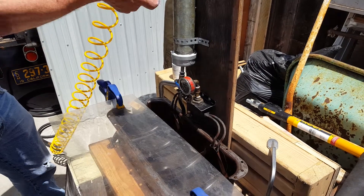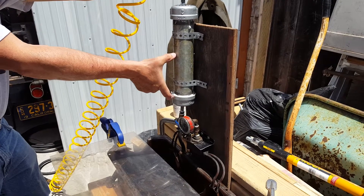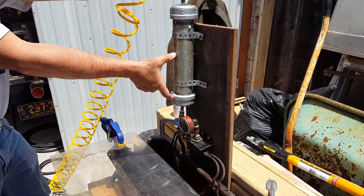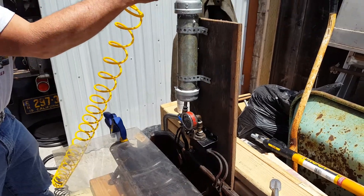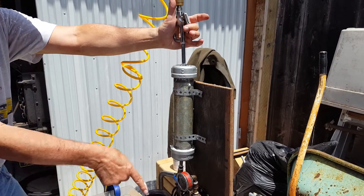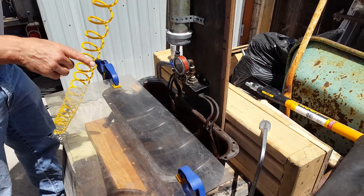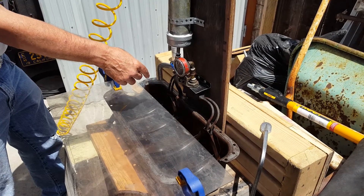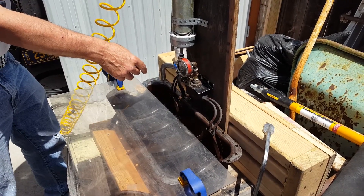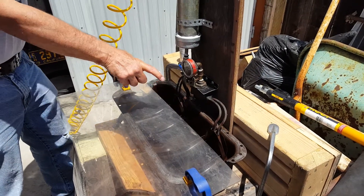The theory is we're going to build up pressure in the upper part of the cylinder. We have about two-thirds filled with used oil. I'm going to open up this valve and then squeeze this trigger, and we'll see what happens to the flow down there. We're going to be looking primarily at the two center troughs where CJP's 29 has suggested that the rod bearings were starved of oil.